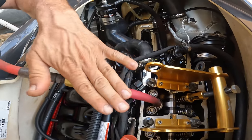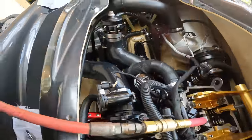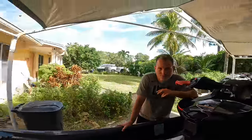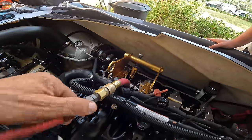You gotta remember, you have to have the air. Now, another thing is how your motor is. When you put air in here, if your valves are leaking, you can hear it. You can hear it on the intake side, you can hear the valves through the supercharger, or if it's on the exhaust, you will hear it through the exhaust right here. So this jetski, like I say, has 103 hours on it. So far, this piston is zero leak down, zero. So that's pretty good.